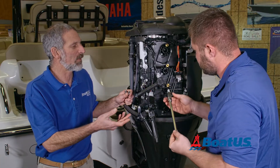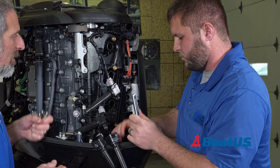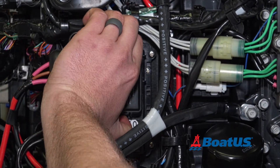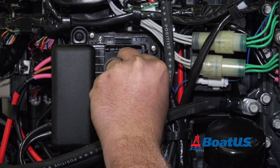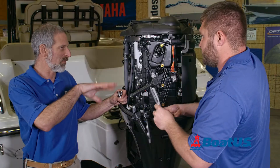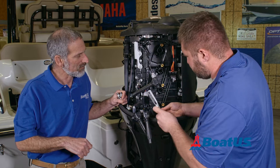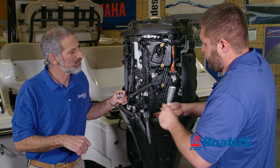What about fuel — isn't fuel flowing into the cylinders when you do this? That is correct. Usually what I normally do is on the side of the engine there's a 15-amp fuse for the fuel pump. I'll take the 15-amp fuse out to keep the fuel pump from pumping fuel. So there's no fuel actually moving through the motor when you're doing this. Because if you get fuel into the cylinders, it will wash out your readings — they'll vary.